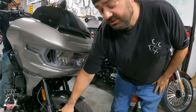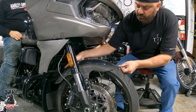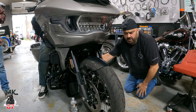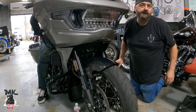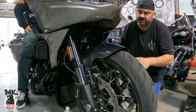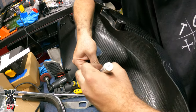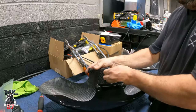So what I did was we mounted the blocks, mounted the front screws in here. So what we can do now is we can rock the fender this way or this way. We're going to pick the position that it looks the best, mark the back, and drill the holes. It looks good right there — it's perfect. How's the back? The back's fine, there's more room in the back than the front. Can we show them how offset that hole is? That's a lot, man — it's a quarter of the hole. This is going to be a great video now.